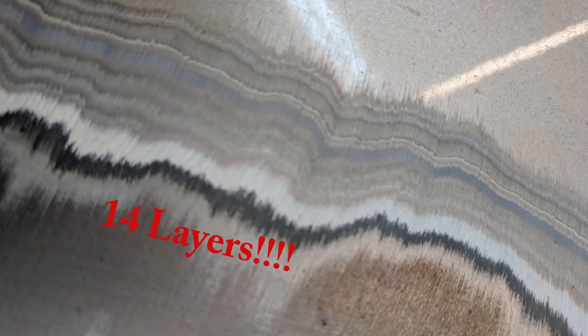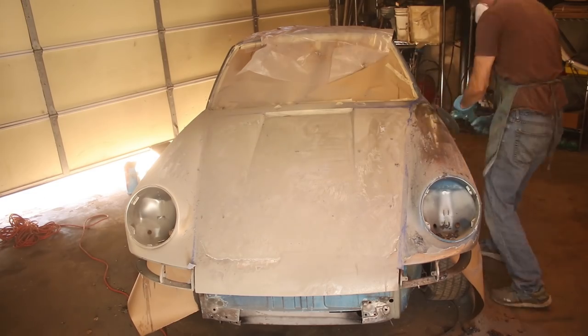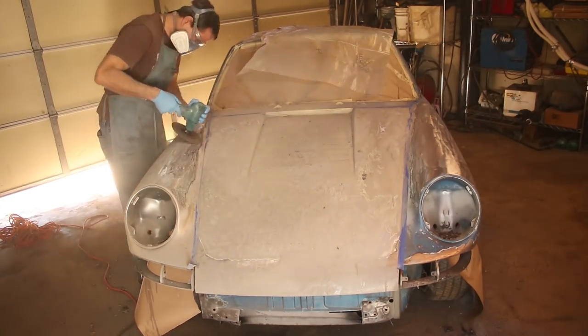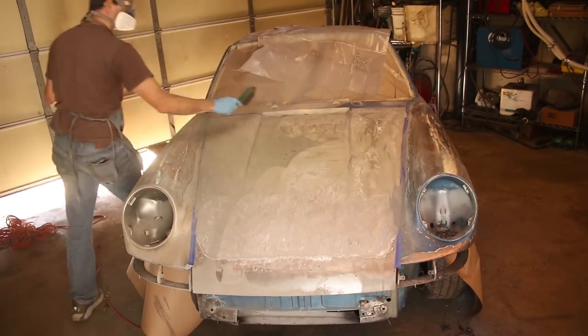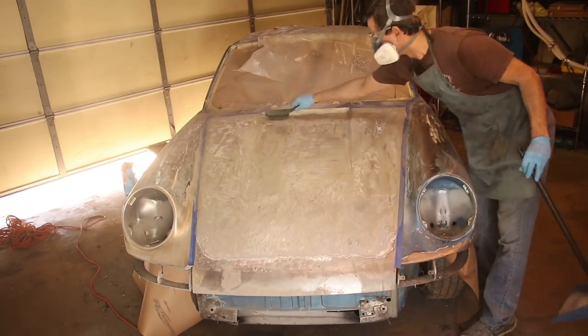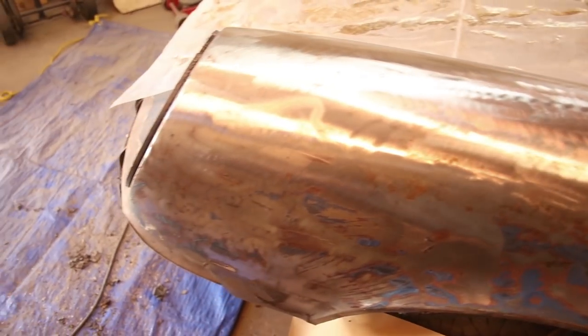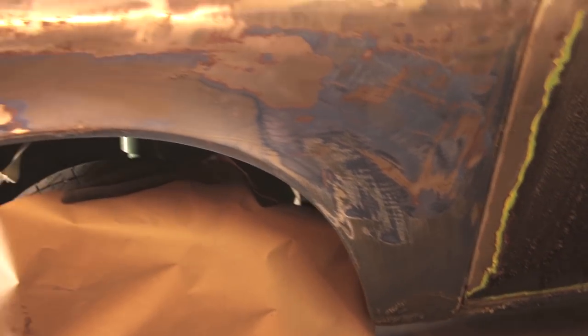This hood has 14 layers of paint, so it's going to need another round of paint stripper. Round one got all the way down to bare metal on the factory paint, but not on the hood. The hood has several layers, but this went really well. It works better on horizontal surfaces than it does on vertical surfaces. Down here, I might just do a real light coat of paint stripper to soften up that last little bit, but the strip-it disc will get this off too.